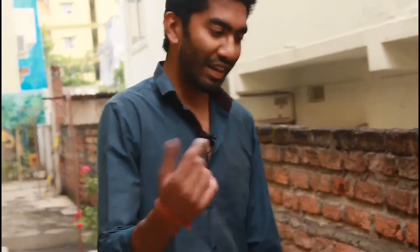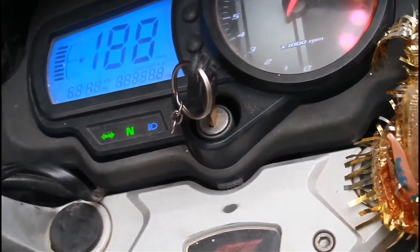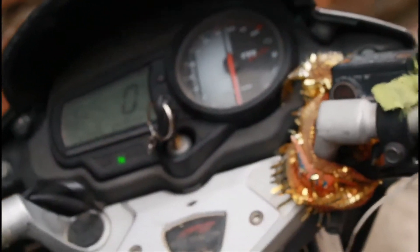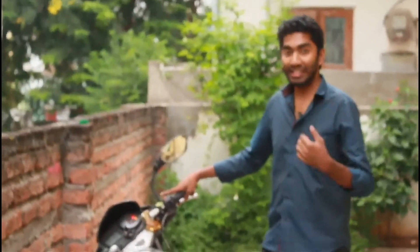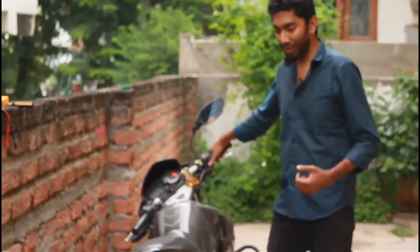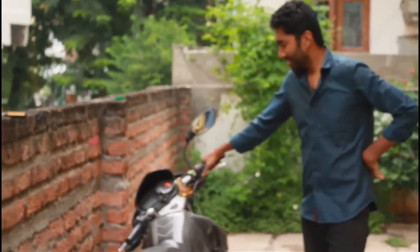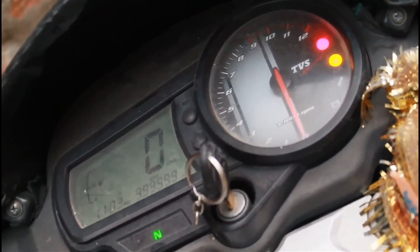I have fixed the lithium batteries in the bike. Let's try to start it. It is turning on — giving the minimum battery requirement to the bike. The engine is turning on and battery temperature looks fine. However, it's not able to take the load of the auto-start.